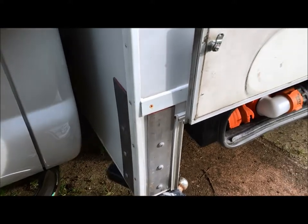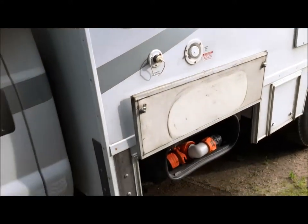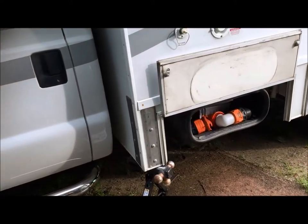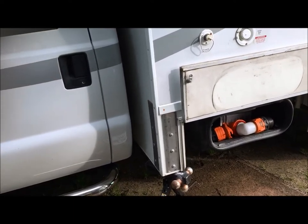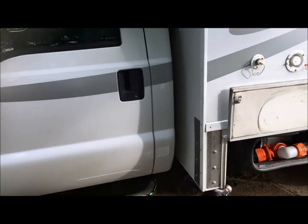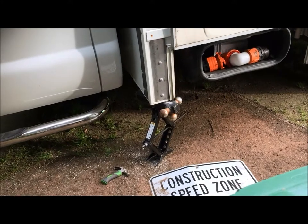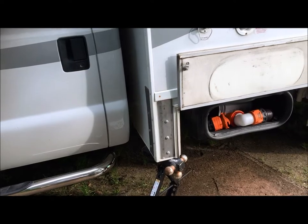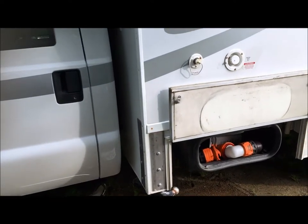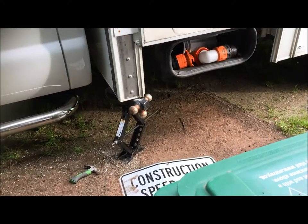All these Class C's with this type of design — the floor is separate from the walls. They put tiny little screws in there, and what happens is those screws rot away and over time it starts bouncing. I took it for some repairs and I believe they lifted the body wrong — the body separated. I can't prove it, but that's probably what happened with the last couple of repairs.